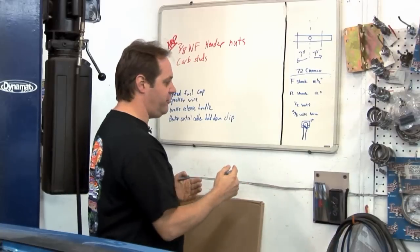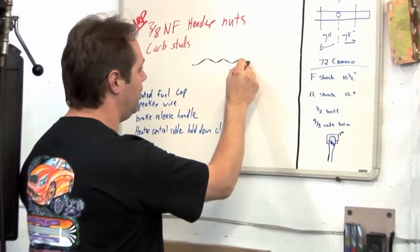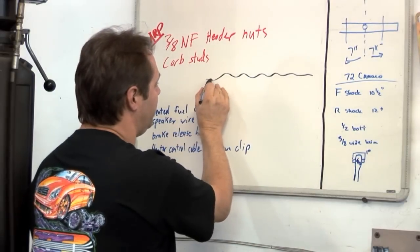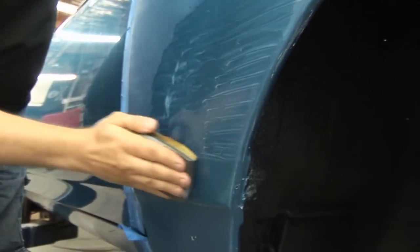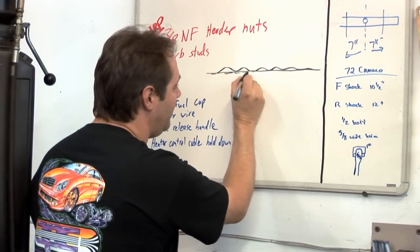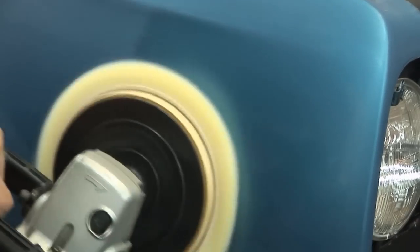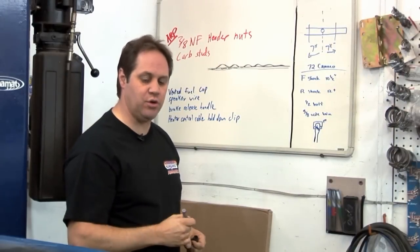Your paint surface when it comes out of the gun isn't smooth — it's actually quite irregular, quite bumpy. What you're going to do is take sandpaper and sand it smooth so that the surface is straight and flat. When you knock this all down with sandpaper you create tiny little divots, tiny little scratches, and then when you go over with the buffer, you take that final level down to super smooth. Now you've got a perfectly flat surface and that's that beautiful show car shine.